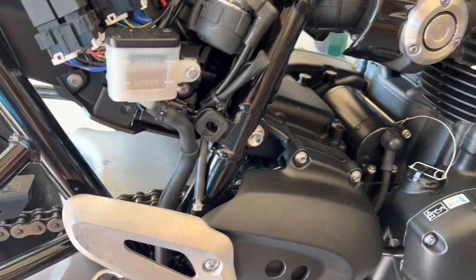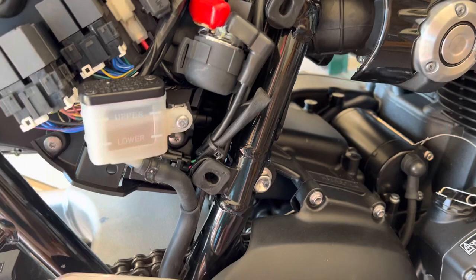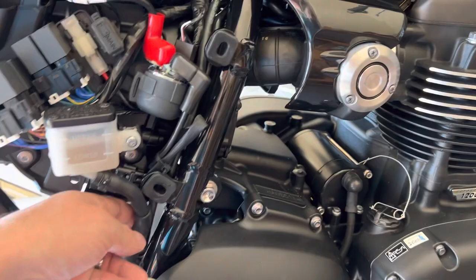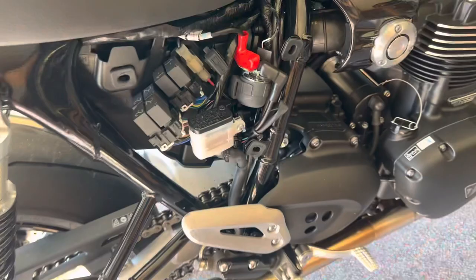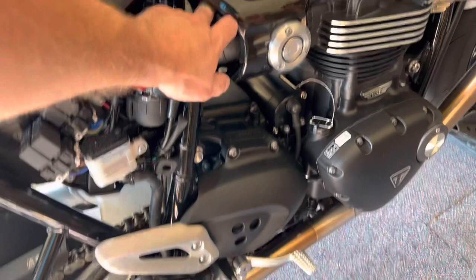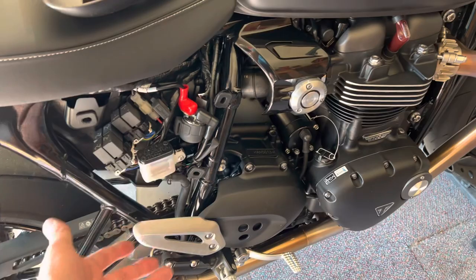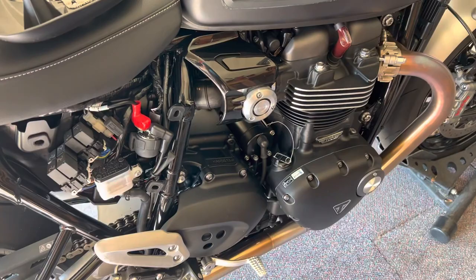I'm doing this as an experiment. As the gas flows through, it's going to pull a slight vacuum — that's probably why I wasn't feeling it; I wasn't at high enough RPMs or working the motor. But I'm sure that at some RPM, that little valve's going to open up and pull a little bit of suction to pull any vapors in from that can. Now that there's no can, I don't want it pulling in dirt or dust from the road that's bypassing the air filter and going right into the intake track. So do the mod — cap this off. The worst it's going to do is try to pull a slight vacuum and just won't be able to suck anything. It's not going to hurt anything; it's just the natural vacuum created at certain RPMs and loads as the air rushes through the intake track.